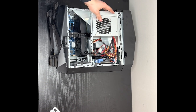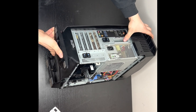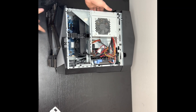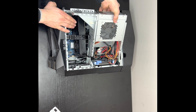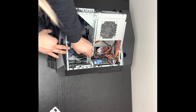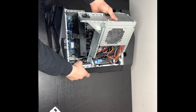Now you want to grab your power supply. With everything open and the tab off, there's a tab on the power supply — you're going to need two hands for this. Pull back on that tab and it pulls right up. Don't go too far though — you want to unplug your GPU first before you get too far so you don't ruin any cables. Just tuck it in and then lift the rest of the way up without hurting anything.